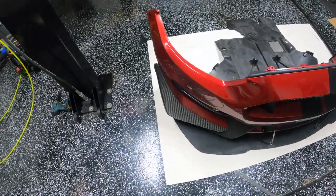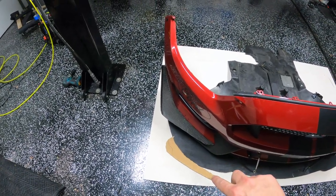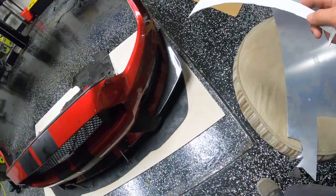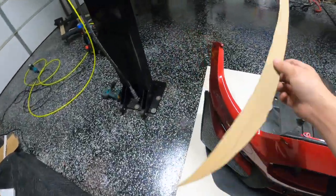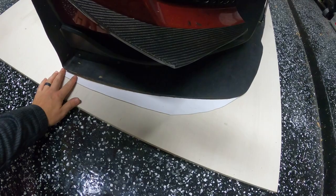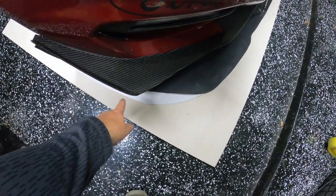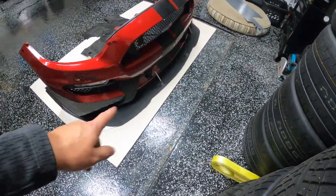One of the things I don't like is that the canards stick out wider than my version of the splitter — it's a bit of an eyesore for me. So I went over and started messing around with some new profiles. I ended up doing some CAD — cardboard aided design — and created myself a little template that will act as a mirror on both sides. If you add the white cardboard to the black, you'll see the new line. It's about the same width as the canard, goes out just a little further to round the profile, and then goes forward. I really like this depth.